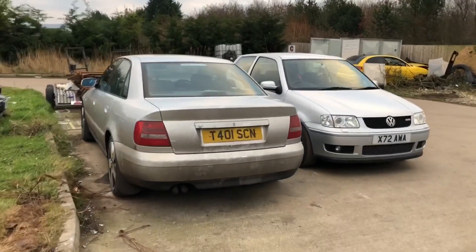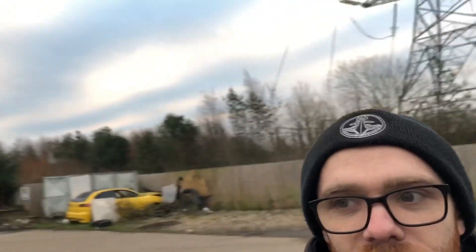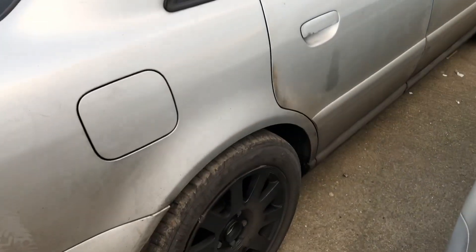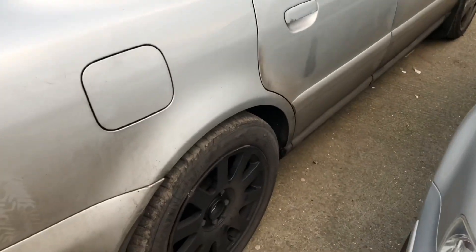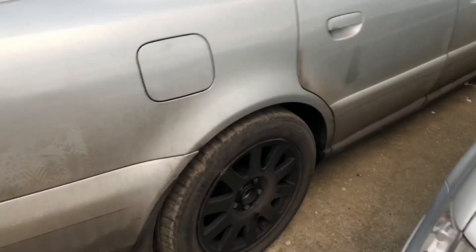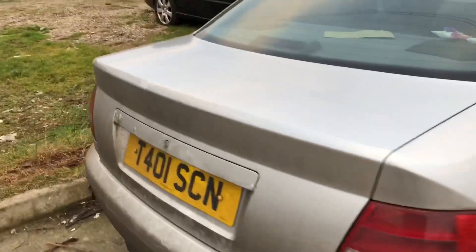Unfortunately the Audi is dead. The rear carrier bolts wouldn't come out of the car - it basically just needs it. It's only got a month's MOT and it's not going to pass one unless I get a dodgy one. So I'm just gonna cut my losses and break it for parts. If anybody's after some Audi B5 A4 parts, let me know. One of the best things about why I'm not keeping it - you can see the movement in the back, the full rear subframe is moving.